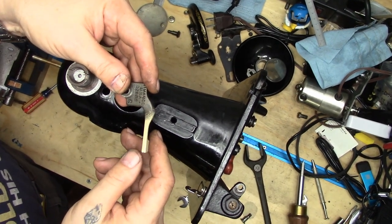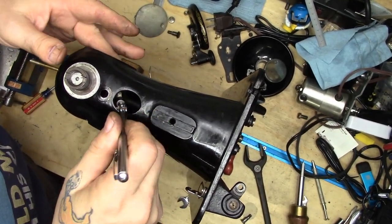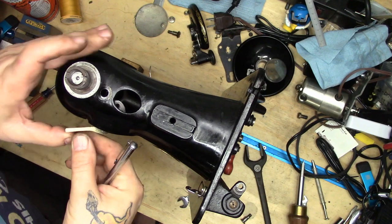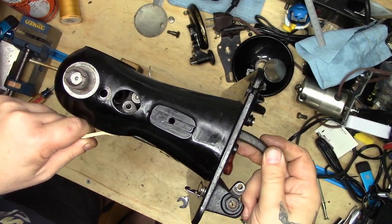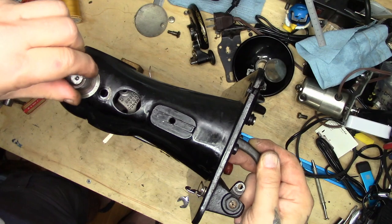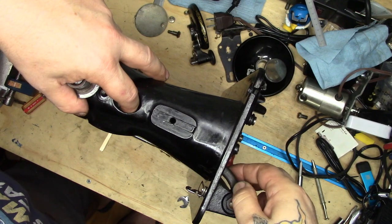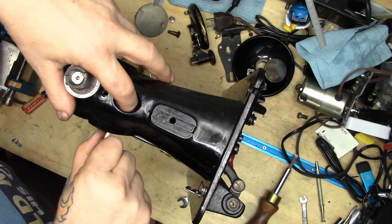We're going to put the adjuster lever in first — put it in through the back. We'll use our magnet on a stick to hold that in position so we can grab it and get the lever arm back out. We'll hold that off to the side. Stick the fork back in through the bottom with the bearing on it, and as we're coming through we can catch the bearing in the slot. Do a little tweaky-tweak with the main shaft. Drop the eccentric bolt back through temporarily just to get it in the hole — now we've got it pretty well lined up.